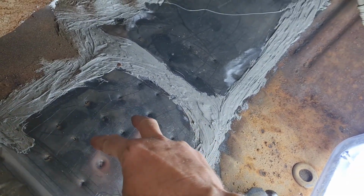And if you listen, what I have noticed as well, that knocking, this is the first time I've done the floor on a C body, and what I've noticed, the floor doesn't get welded to the chassis rail like it does in the trunk when I've done the trunk floor. But the B bodies, they do. These ones don't, which I found a bit strange, but hey, it is what it is.